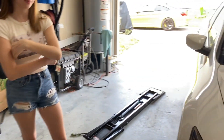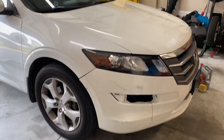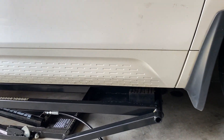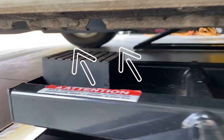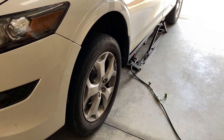We're going to have Regan do this oil change on her own. We'll start with a set of quick jacks. The first thing you have to do is raise your car so you can get underneath to where the oil drain plug is. At home, you can use front ramps to drive the front wheels up. If you're using jacks and jack stands, the jack points are right here — you can see the extra thick metal that's meant for your jack. With the quick jack, just place the blocks under there and press the up button, and your car goes up. It has safety stops so it will not fall down on you.